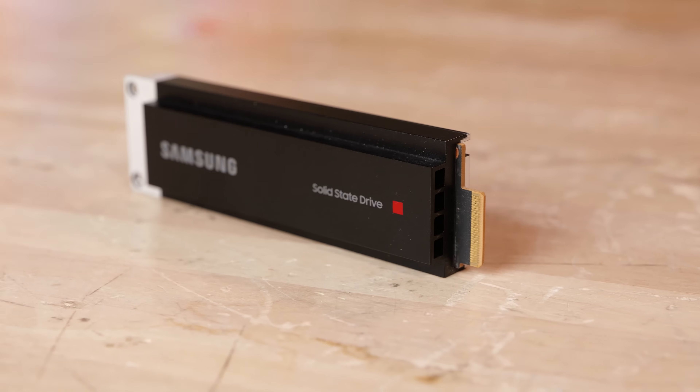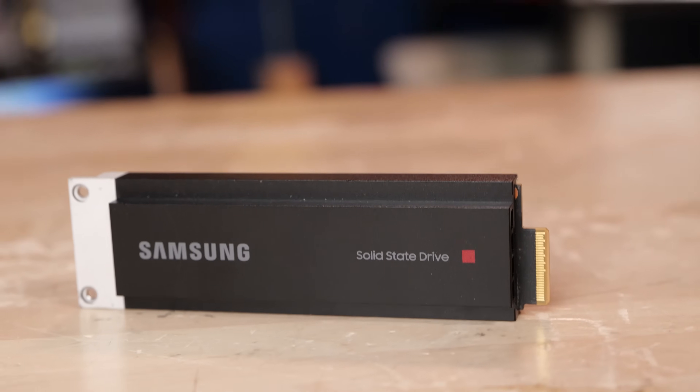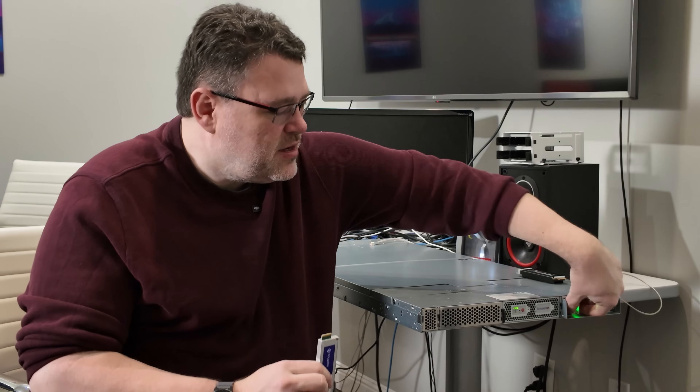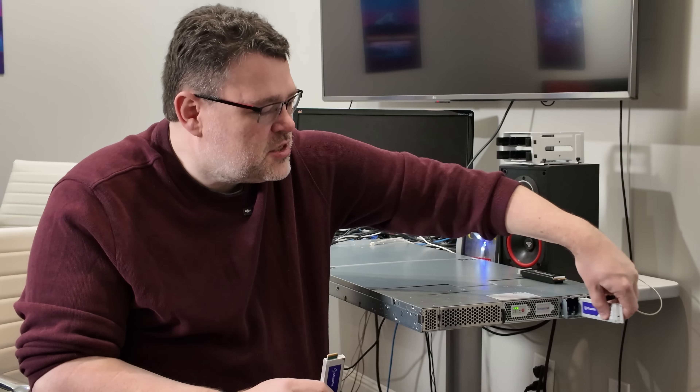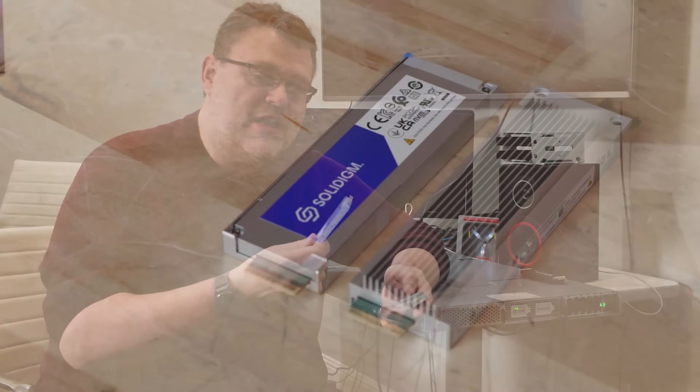This is an E1.S drive — the Samsung PM9A3. There are eight of these E1 drives at the front of this machine; it's a density play. But the Solidigm PS1010 puts that PM9A3 to shame, mainly because the 9A3 is a little bit of an older drive. Technology is moving so quickly that there is both an air-cooled and a liquid-cooled version of this E1.S D7 PS1010 from Solidigm, featuring 176 layers of V7 flash.